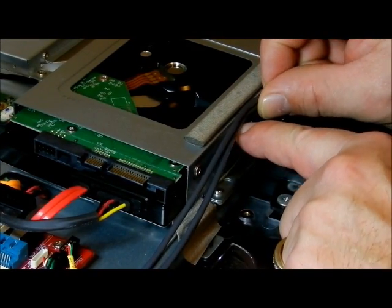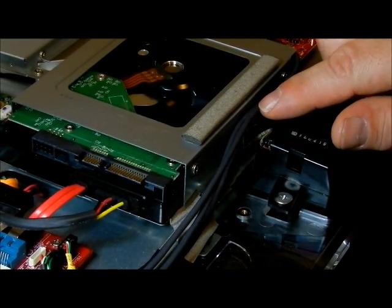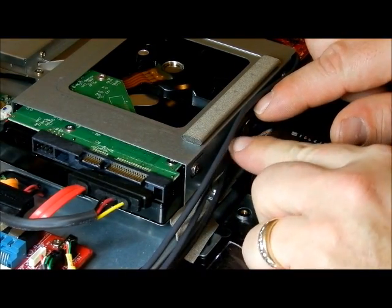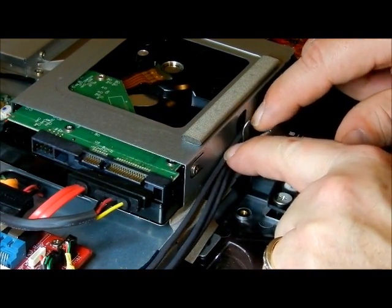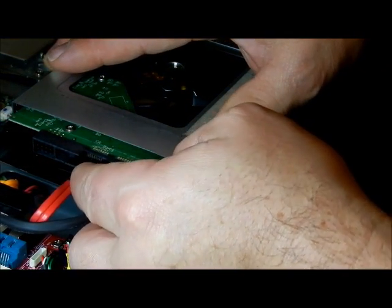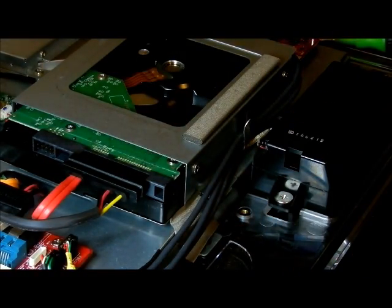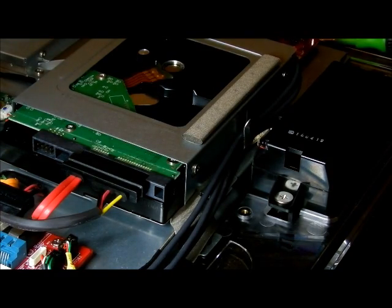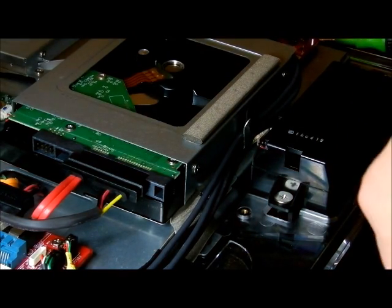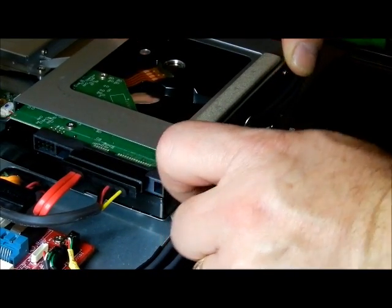The big slot has to go on top of the pin on both sides and slide back. Before we screw it down, we're going to put the tape back for the speaker. These three wires we're going to put in one at a time — just slide them in all the way down. Hook up the connector — it only goes on one way, just wiggle it back and forth and press it on. Take the one screw that we set aside. There's a bracket on the other side — slide it through, pop it in, and slide it back.